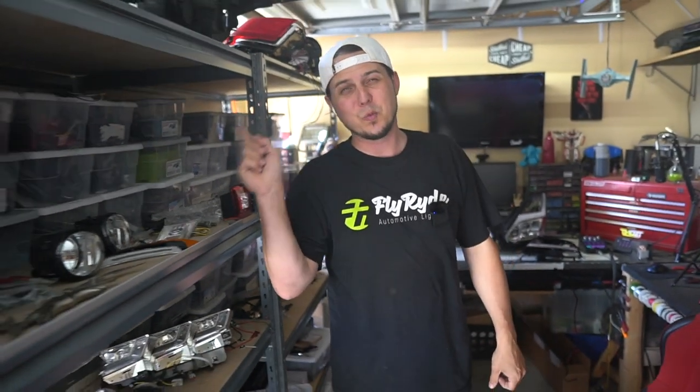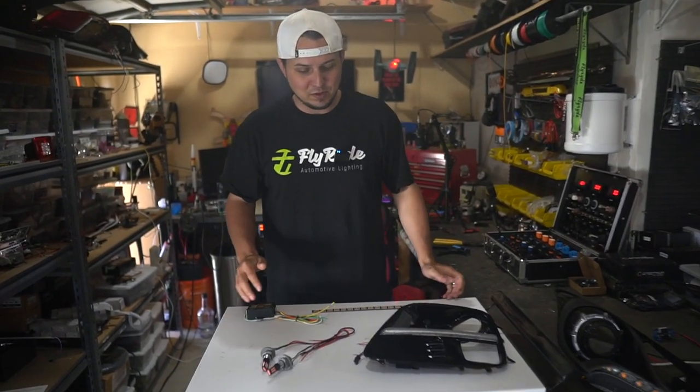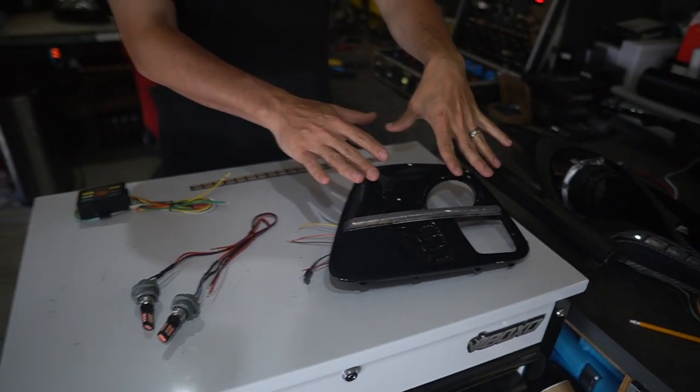I'm going to connect this controller that goes from two-wire to three-wire for the brake lights. My car was giving weird voltage — like 10 volts and 5 volts on different wires. I don't really know why it was doing that, but we're going to first bench test this, then find another vehicle that's local that's not screwed up. It was a disaster so far, but I'm going to try to get organized and make this valuable to you.